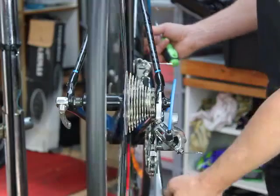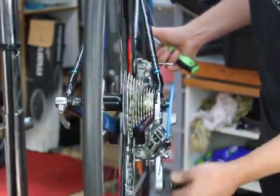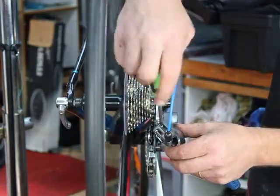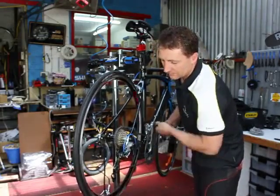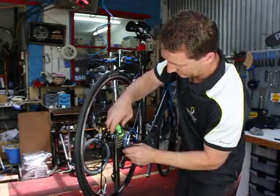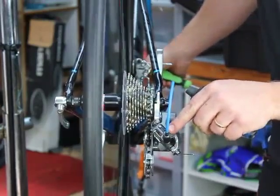As we turn the crank over we can just grab the exposed cable for the rear derailleur and pull it up by hand. As you can see it's got full range on the cassette. If I adjust the L screw and try that again, you'll hear it's just starting to not want to go into gear. Now if I pull the cable, we're missing two top gears and one bottom gear because I've wound both those screws in a couple of turns.